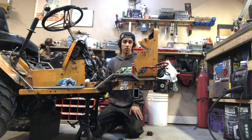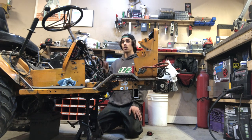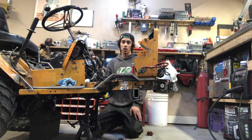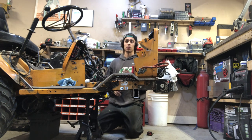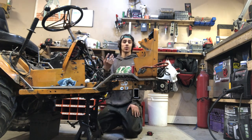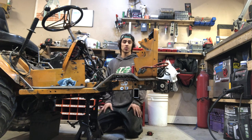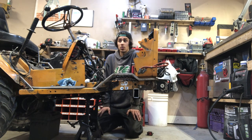I am doing a swing beam setup, which is identical to the factory front axle, but I'm going to be building it a lot stronger — with bigger spindles, stronger steering arms, and a way better articulation spot. I think that's just going to be a much stronger pivot point, and I'll be able to grease it. I don't see anyone else doing that kind of thing, so I'm going to give it a shot.